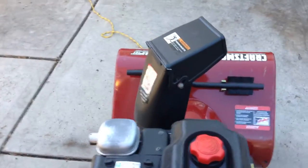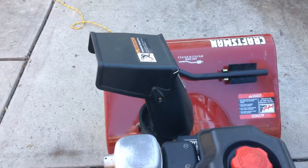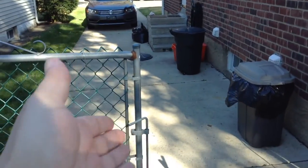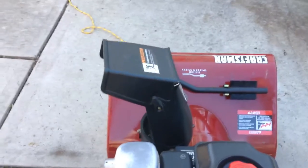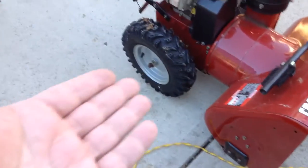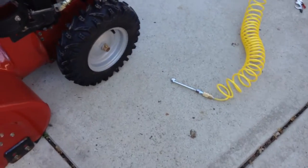There was a more expensive model — I suggest going with that. This chute turns, which is great, but when you're moving it around it kind of oscillates. When it's running and you go all the way left, for instance, you come out of the shed, go up the driveway, and throw the snow to the side — it kind of drifts with you, take my word for it. You might also notice the Harbor Freight central pneumatic compressor out — the tires go flat, but they're so thick they don't actually bottom out to the rim. I read the sidewalls; it says no more than 20 PSI.